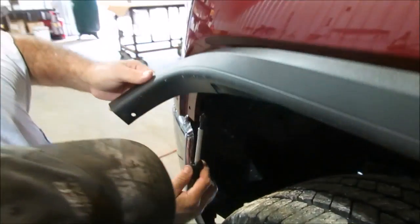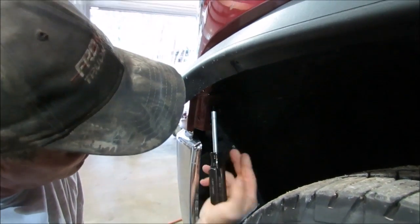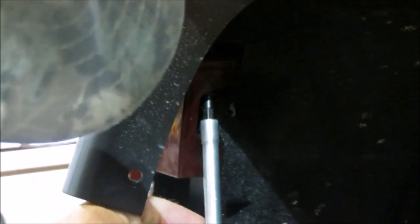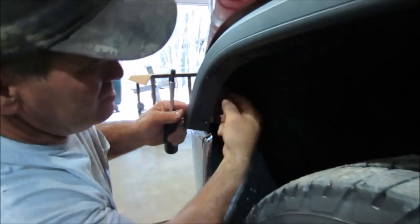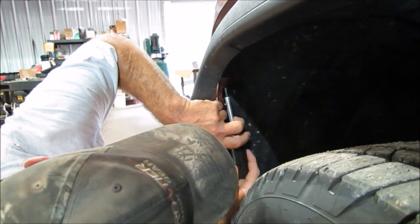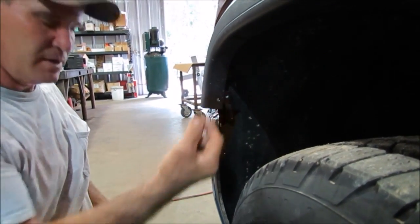Jonathan's going to get over here. Once you get it, there's a little pocket right there — you're just going to go straight up and it's going to be right there. You're just going to take that 9/32 bolt out. And it's loose, just hanging there, still in the thread. There's that little bolt that's got to come out.